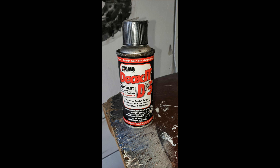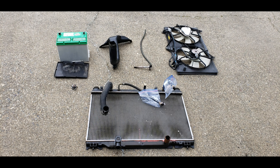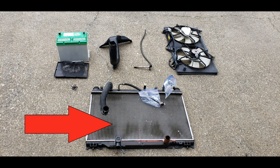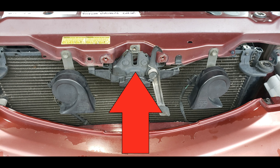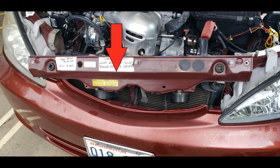As a bonus, don't forget to pick up some dielectric or conductive spray. Since you're disconnecting your battery, you might as well properly treat it when you put it back together. When applied to the terminal posts, it'll improve your electrical conductivity as well as seal and protect your terminal connectors. Here's a quick overview of what's involved: we'll remove the radiator cap, the overflow hose, the battery and battery tray, the air scoop going to the air cleaner, the engine fan assembly, and of course the radiator itself.